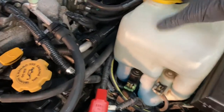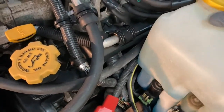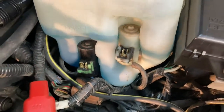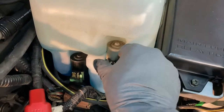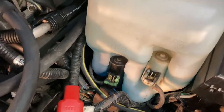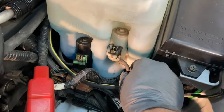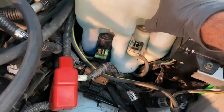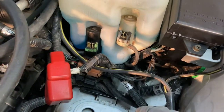Removing the reservoir is pretty straightforward — you just have these two bolts up here and the reservoir actually just rests on top of a little plate down there. You'll have two electrical connections that you'll have to take off. Thankfully my reservoir isn't completely full, so I should be able to just remove the lines going to the reservoir and just tilt it on its side to keep it from leaking.